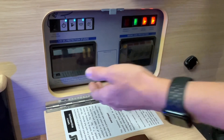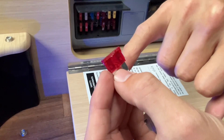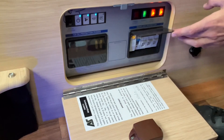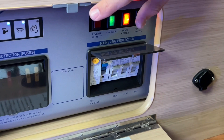All your 12 volt fuses are here — do carry some spare fuses with you. If there's a fuse blown, pick it out. You can see if a fuse is okay because it's got its wiggly bits still intact; if it's blown they'd be separate and you'd just pop a new fuse in to the same rating. On this side you do have your trips — if you've tripped the vehicle out, try here before you try the main side, as it may be you've overloaded the feed inside the van. If you weren't receiving power, the best way to check is trip the vehicle — if it trips you've got power, if it doesn't you're not receiving power. You can also check if the microwave lights up.